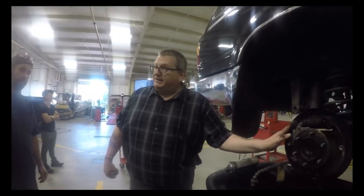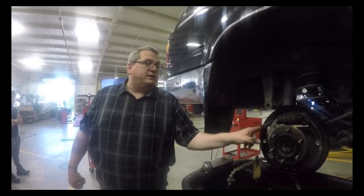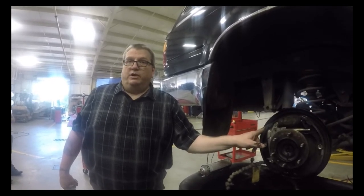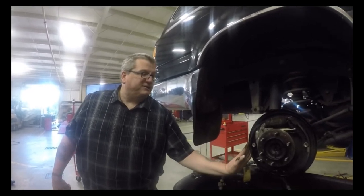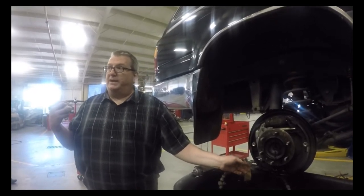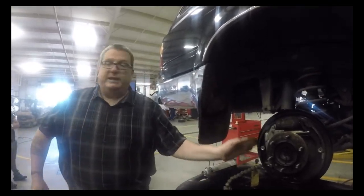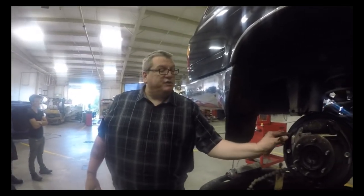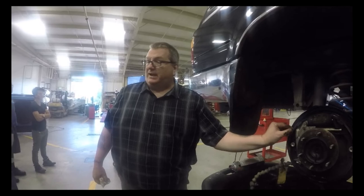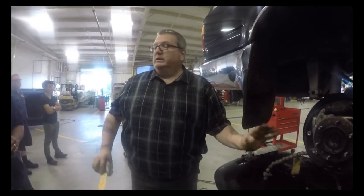And again, I have to say this because I do have students that ask this. If I spray it with the brake clean and there's still grease on there, can I take sandpaper to it? No, because this has to be perfectly shaped to that drum. If you take sandpaper or my die grinder, you're putting gouges in here. You couldn't use a wire brush either. No. Actually, if you start to use a wire brush on here, you can feel these. I mean, you can almost break them apart. You're just gonna tear it up. Let it go. Either replace them or just put them on and hope they're not too bad, okay?